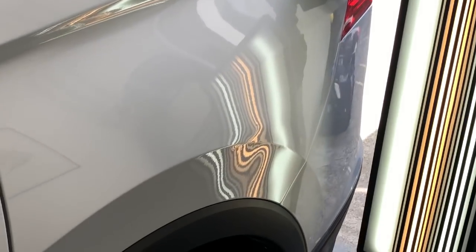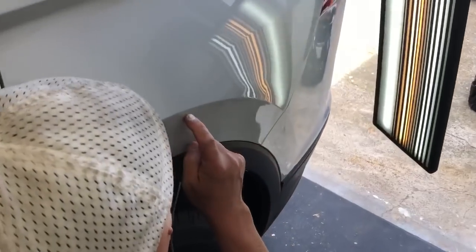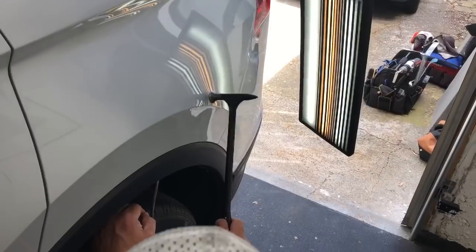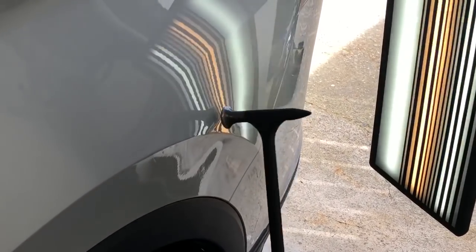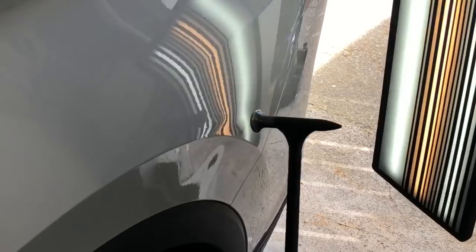We'll finish this dent off and come back and show you guys the end result. Hey guys, we're back — I got a lot of this line out and you can see it got real severe right about here. No broken paint, no real severe push marks — just a couple of real tiny push marks. I still see I've got a little bit of this brow to take out. You can actually see it — when I hit up here on this brow it starts to want to move down here because it wants to reset that metal. If I hit on the right spot it'll actually want to move that metal back to flat because there's nowhere else for it to go.